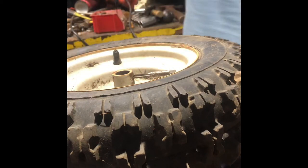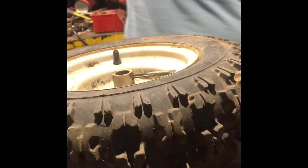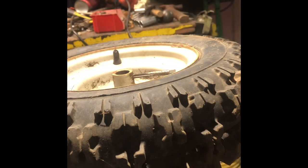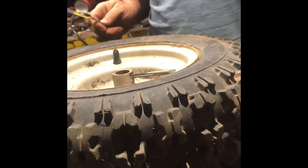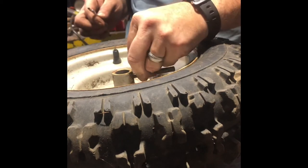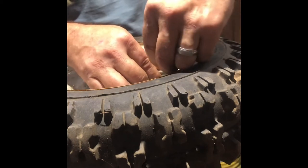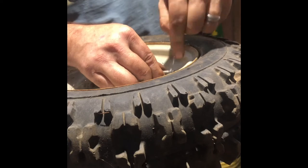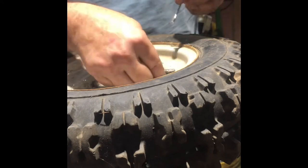You should put a little bit of oil on there. My PB Blaster seems to have gone upstairs or out to the other mower, and the other can is empty, so we're going to use boiled linseed oil — I know it sounds crazy, but anything to reduce friction. Just a smidge. I might have to use needle nose vice grips to turn the tap and keep it straight.